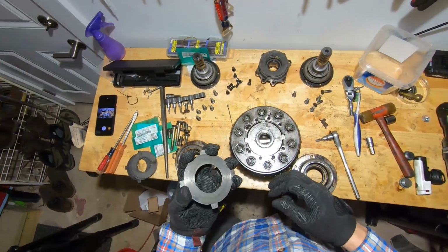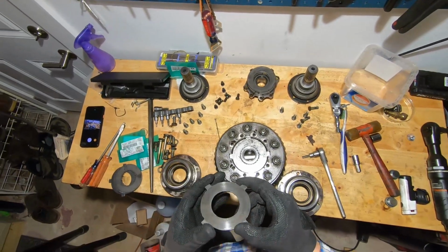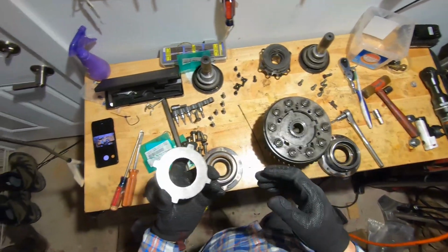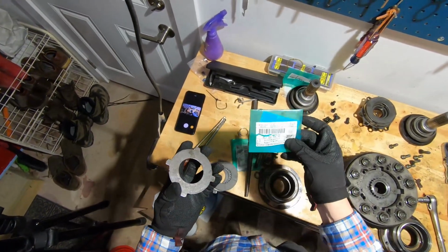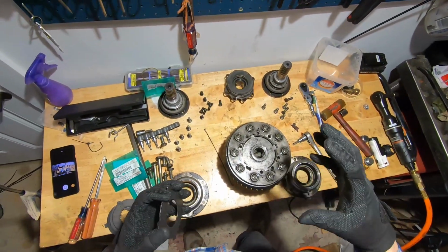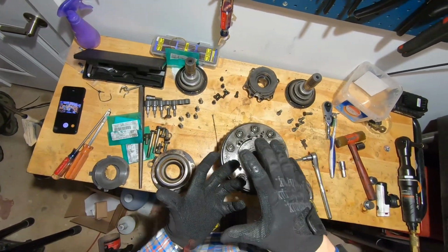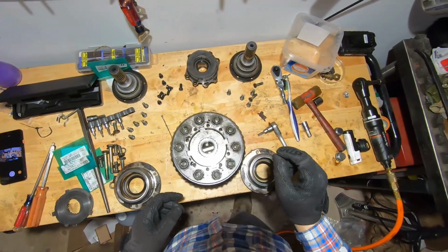So you can get these in 1.9 and also 2.1 millimeters. Some of these LSDs come with 1.9s. Some of them, I guess, come with 2.0s. When you buy these new dog ears, get them in the 2.1 because it'll increase the speed with which everything locks up, because there's already some additional tension built up in the LSD based on the stack, slightly increasing the stack height.